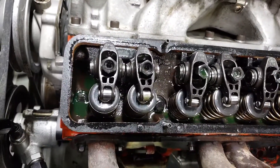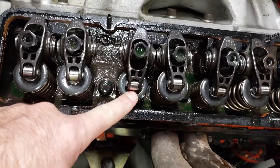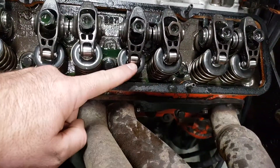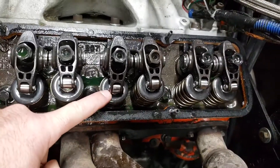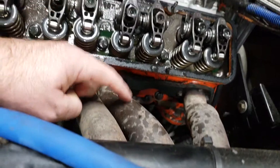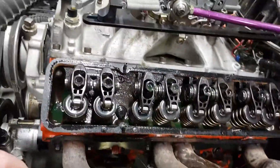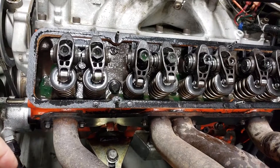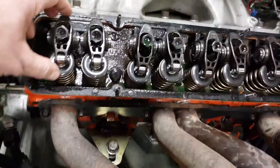So for the cam, there's no pressure on the lifters — no pressure on the lifters pushing up on the push rod, putting any pressure on these rocker arms pushing down on the valve. So the valves are completely closed. Part of what we're going to do to winterize this thing is actually back off all the valves. As you can see, this one is being pushed down, which leaves the valve open — that's on the intake side. This one is on the exhaust side, meaning the hole on the other side of the header tube is open into the cylinder. For years and years, I did not used to back off my valves during the winterization process. This is something I picked up for longevity — it gets pressure off your springs.